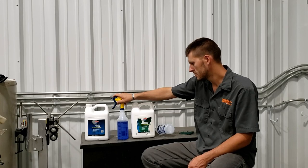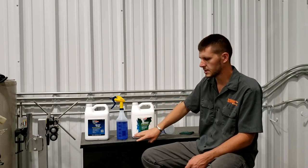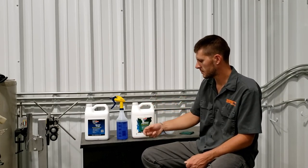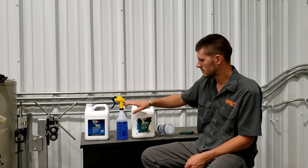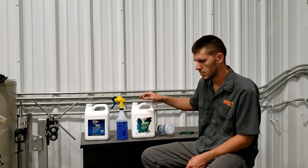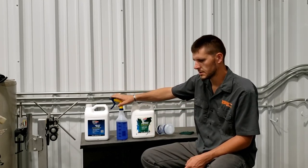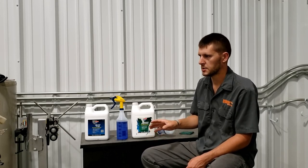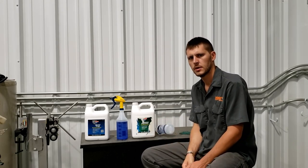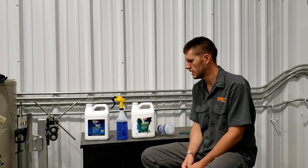And so if you see in my pictures, and I have these on Instagram too if you're interested in looking at them closer, you start out with a silver sandblasted frame, you degrease it, hose it down, it looks a little bit duller gray after that, but not much. Then you hit it with this, and then you wash it and dry it, and once you get it dry, it's gold. So it doesn't really look like surface rust, but it's kind of that gold, slightly brownish orange color.